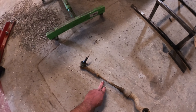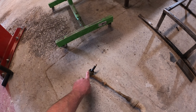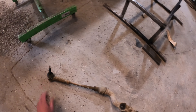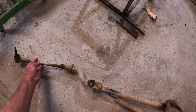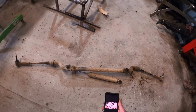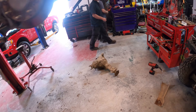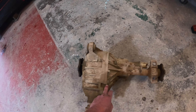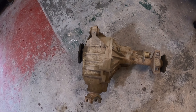On the other side, here's my inner and here's my outer. These guys pivot back and forth and actually turn inside this socket so that as I'm going around corners, steering, or the suspension is moving up and down, they can move in all different directions. The inner tie rod end is also able to move and pivot. That's out of this truck, and we also ended up dropping out the actual front differential assembly, which is right here.